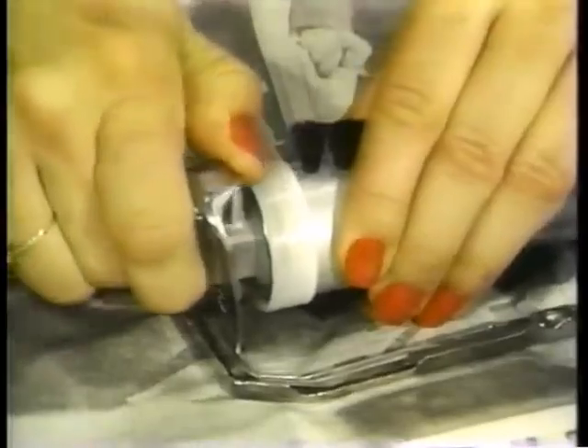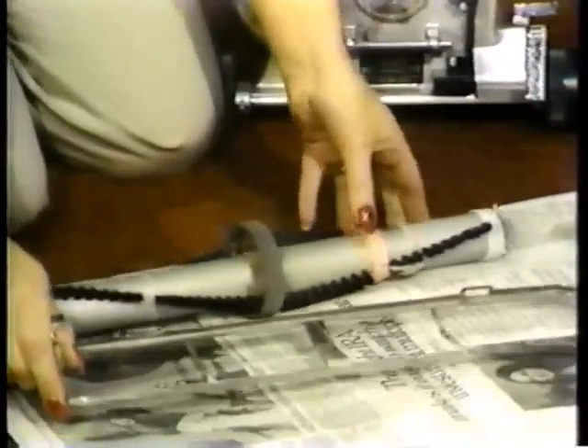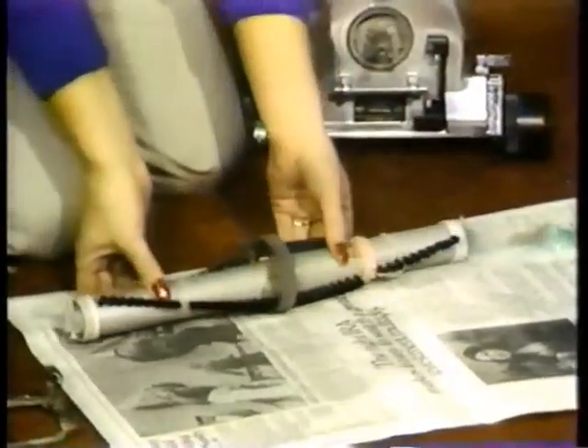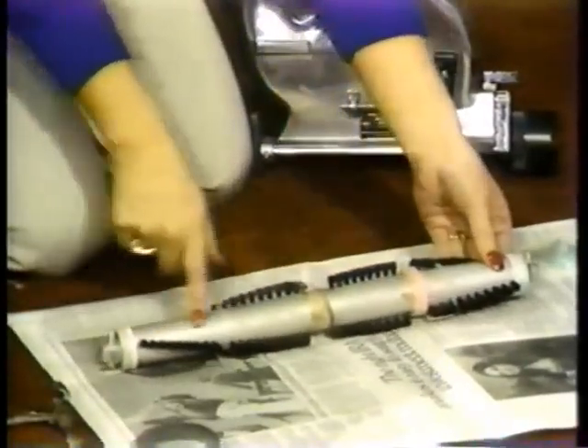Slightly bend one end bracket of the rug plate and remove the brush roll, making sure to lay it down in the same position as it came out of the rug plate. Look at the rug plate gasket and remove any dirt or lint. Remove the worn belt and check the brush roll for strings, thread, or hair which may have wound around the brush.